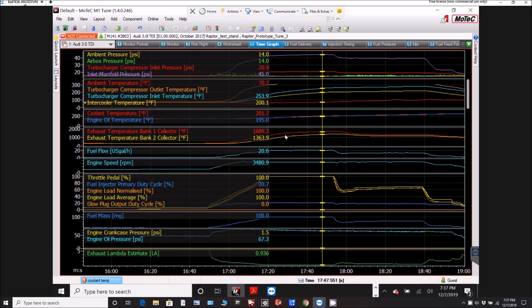Looking at the log for that run. Before I dropped the power off, the EGTs were around about 1700, just over. That's when I decided I don't really want to run over 1750, even though it looks like it was stabilizing. When I backed the power off it didn't take much to have the EGTs drop down to about 1300. Remember these EGTs are about 30% higher than the actual exhaust, at least that's what I calculated, just because of where my sensor is. The exhaust lambda was 0.93, so maybe a little bit of black smoke, and fuel flow was 20 gallons an hour. The governor was keeping it at about 3470 RPM.